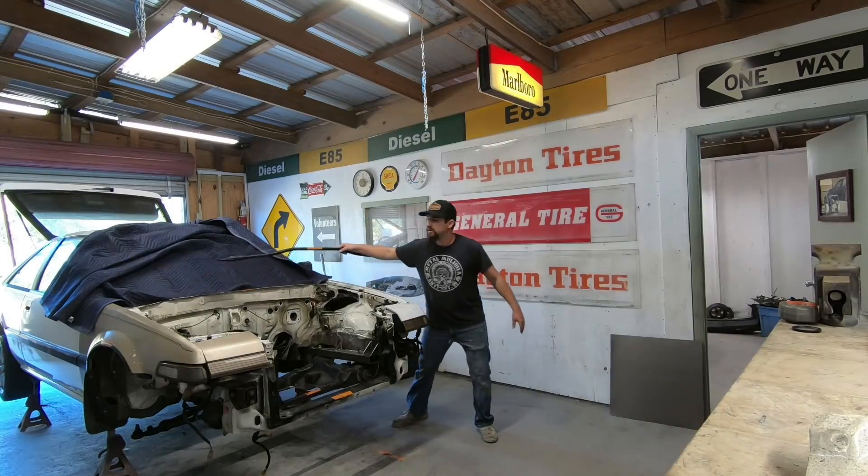Toe we don't have to worry about because everything is level and aligned — toe will be adjusted with the actual steering rack. Toe is if you're looking down the front of the car, wheels in or wheels out. Camber is the next thing — that's how far the top of the tire is leaning in or out, positive or negative. The way we're going to assure camber is the exact same way the engineers designed it in the GTO: this is the strut tower brace, and it keeps those strut towers at the exact same distance apart as they were in the GTO.